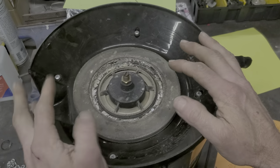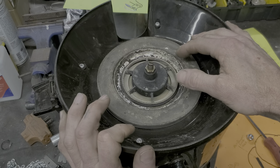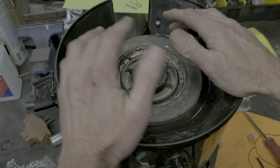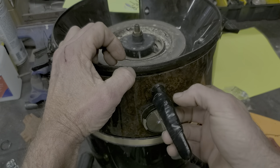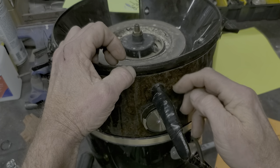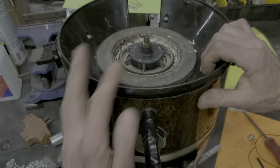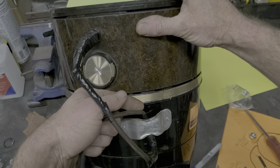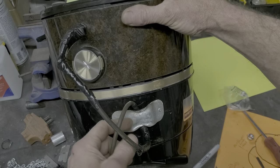There wasn't anything on YouTube, so I figured I'd throw something on for everybody. Another addition: since everybody vacuums by pulling and pulling on the cord until it gets pulled out of the wall, what ends up happening is the power wires end up broken. What I did is I took some wire crimps, crimped them back together for a good connection, then taped it to get a real solid collar, folded the wire, taped it up even more, and hopefully made it wife and daughter proof. So now instead of pulling at the unit end, they pull right at the new reinforced spot. That end could break, but at least I'll have a lot more room to fix that wire than having to go in and replace the whole wire.